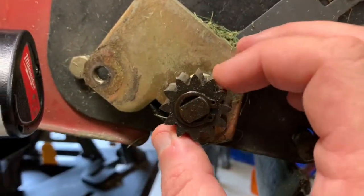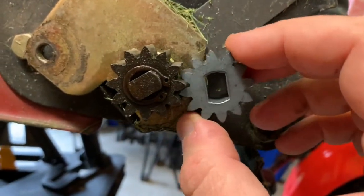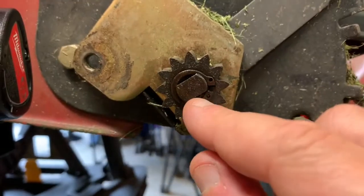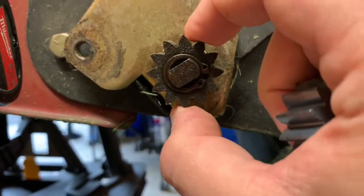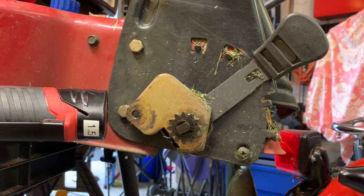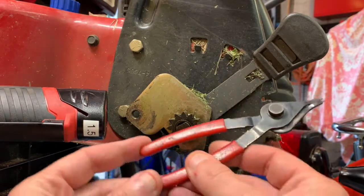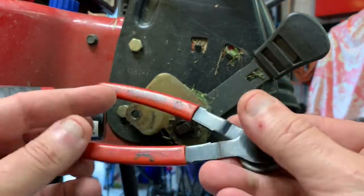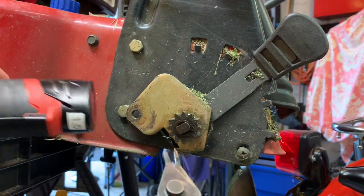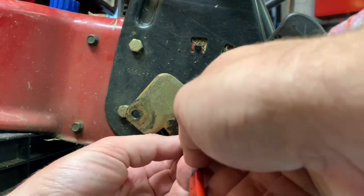The pinion is really sharp — let's hold it up against the cog. I probably didn't need to replace the pinions but I'll replace them anyway, so to get the pinions off — I'm gonna pull that little circlip off. You're going to need a pair of snap ring pliers. These are Blue Point ones from years ago — tips are a little worn, but you got to be careful with snap ring pliers because they do like to snap and ring you right in the eye.